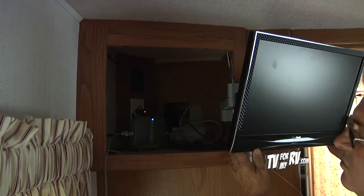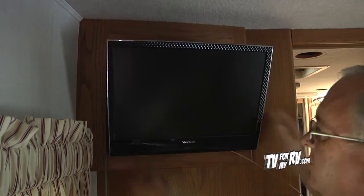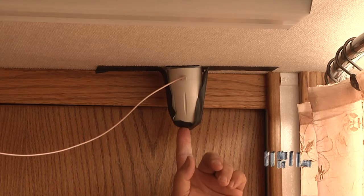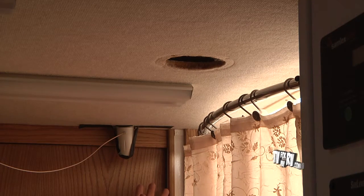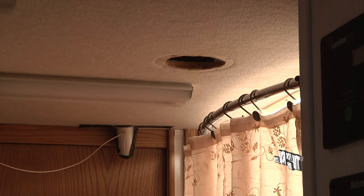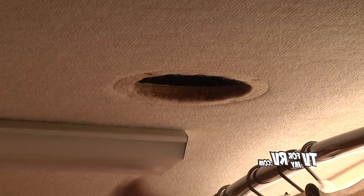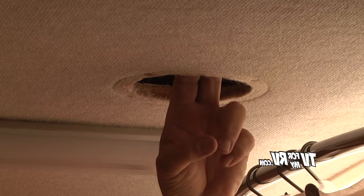Once this is permanently installed, you won't even see it behind the TV. Successful booster operation also depends on correct orientation of the antennas — the roof antenna should be pointed up and the indoor antenna should be mounted pointing down. The reason I wanted to test this location is that it's relatively in the middle of the coach and it has easy access to the air conditioning duct right above it, so this will be the route we run the interior cable back to the booster box.